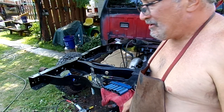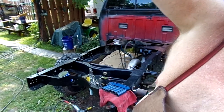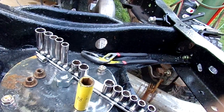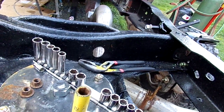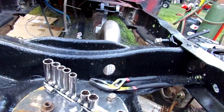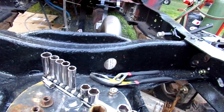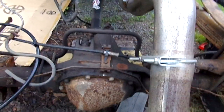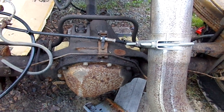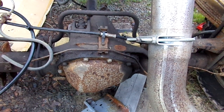All right, our tire carrier is in, and I actually recollected. This is why I save pictures, and this is why I like doing YouTube. I'm going to make a spanner that spans the rim for this truck, and it'll span the wheel, and then I'll just be able to slide it up on the spanner. That's the best way to do that, and then I'll just make a regular nut with a greased, stainless steel plate. Okay. So now my tip here is, I'm going to disassemble this just the way it is, and that way I can get the length of my lines right. Just by taking it apart, I don't have to goof around with anything.